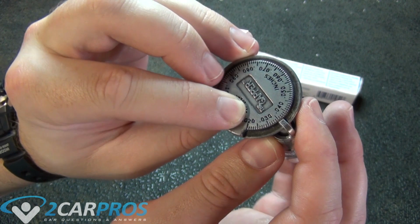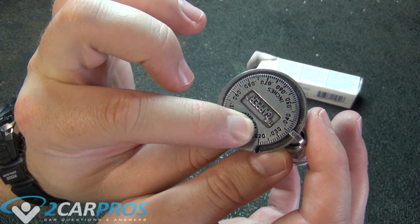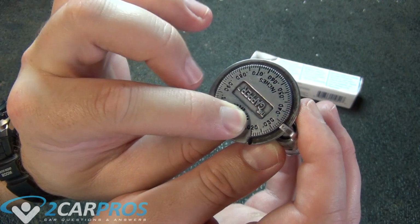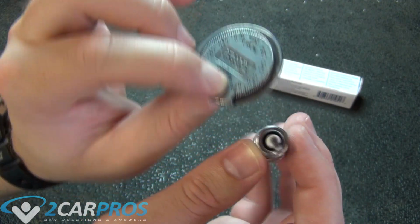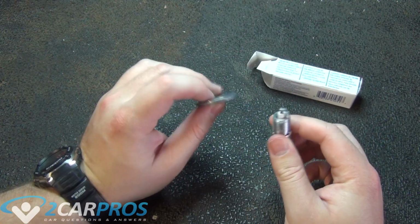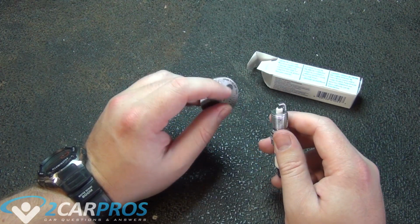See, it stops here at 0.035 inches. So that's quite a bit away. I can't move it any further up to 4/100ths of an inch, where it needs to be according to the manufacturer's spec, which is always going to be a little different depending on engine and configuration. So just look it up per application. It'll be in your owner's manual. You can even find the information online.